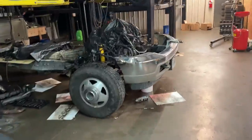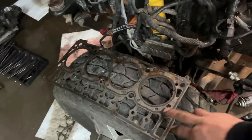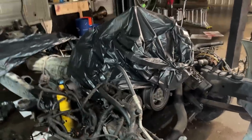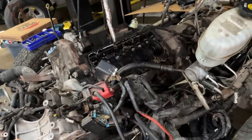This is the first time we've ever had two cabs up at the same time. This 6 liter unfortunately needs new heads because the heads had already been machined and they got too thin. Yes, if you have studs or a bulletproof 6 liter, it could still fail. Nothing is impervious to heat, which is, this one got overheated, blew the head gaskets. This was just a factory head bolt LBZ that suffered a head gasket failure.